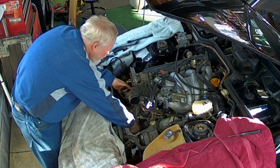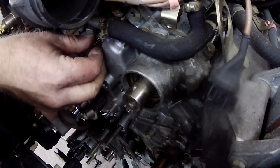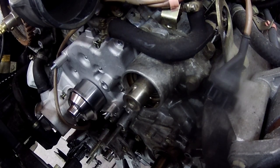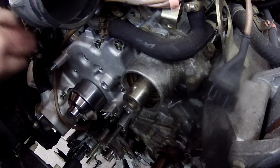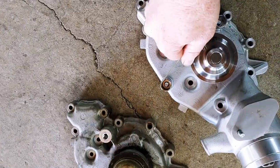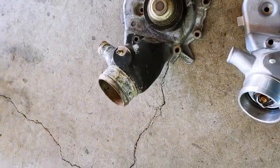With everything off, I cleaned up the gasket surfaces. I also noticed an oil seepage on the lower balance shaft seal, so I ordered the seal kit and kept moving on. I installed the upgraded water pump using the bolts supplied by 944 Online. The back timing cover needs a modification to fit over this new water pump. The updated water pump has a belt shield that the early water pump doesn't have, and at first I just drilled holes for the mounting studs for the new water pump, since there wasn't any description showing how to make this modification.